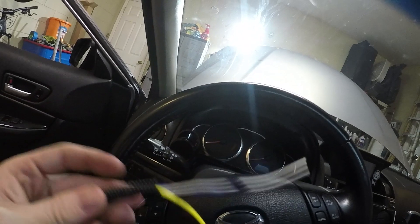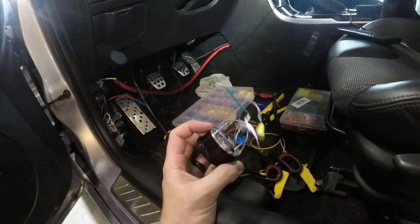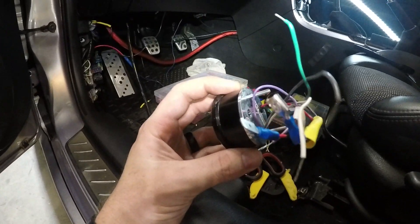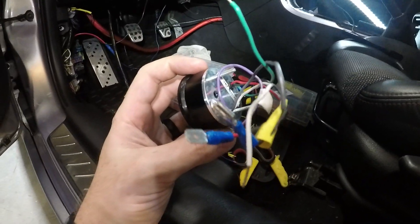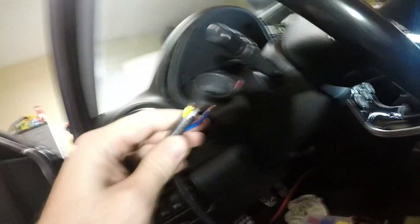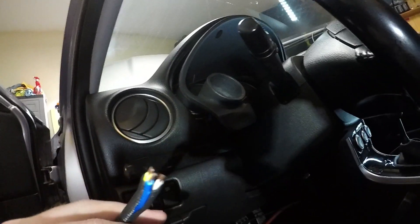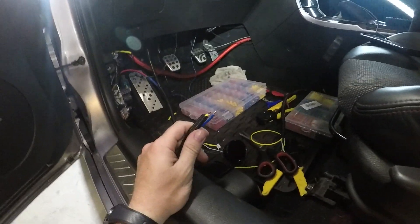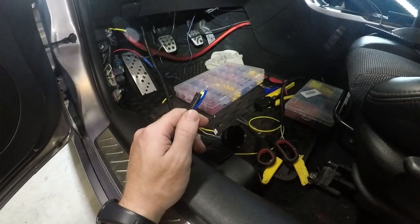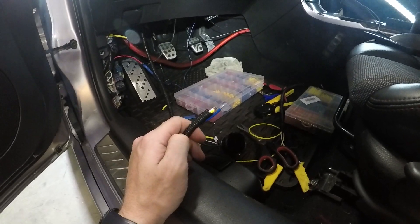So I'm going to go ahead and cut this, get it to size, add the connectors. What I ended up doing was I actually just unplugged the gauge. I'm going to add male-female connectors to the back of these wires so that I can pull them out if I ever need to remove the gauge to get behind the cluster or anything like that. I removed those, ran the wire as far as I needed with a little bit of extra, and I have plenty of space to tuck it up underneath the dashboard. So I'm going to go ahead and put the male-female connectors on now — it's much easier this way, that way I'm not up underneath the dash wiring things up when I don't need to be.